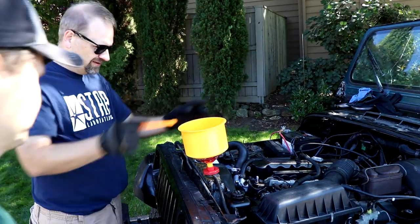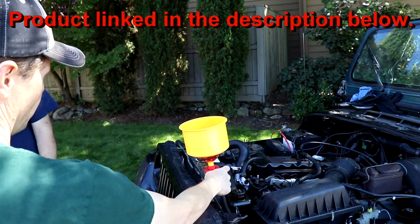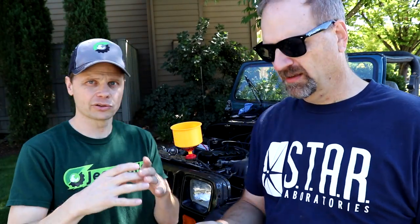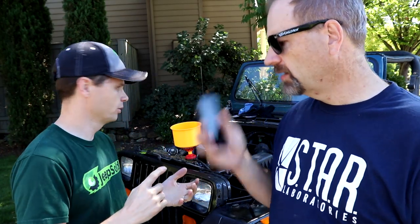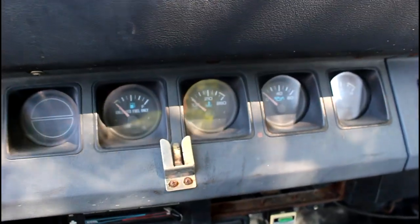I love this coolant burping system — it's great. As the thermostat opens, we're going to have air coming out, so we'll fill this up a little ways and burp the system. All right, we're all set. We're going to fire it up. I'm going to keep the RPMs between 1,800 to 2,500, kind of varying in that area, for about a half hour to start seating those rings and breaking it in. We'll set a timer to watch that. We're also going to be watching oil pressure — very first thing, we want to see that oil pressure come up. If it doesn't, we've got to shut it down. And we're going to watch the engine temperature. Jason's going to be out here watching for leaks.